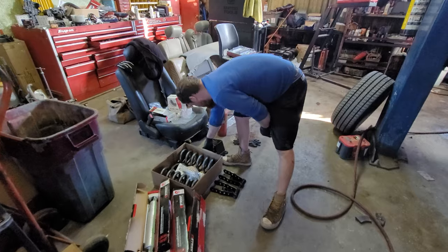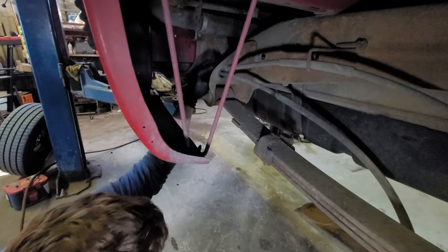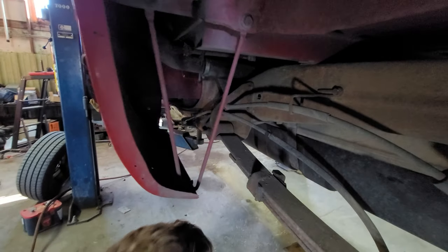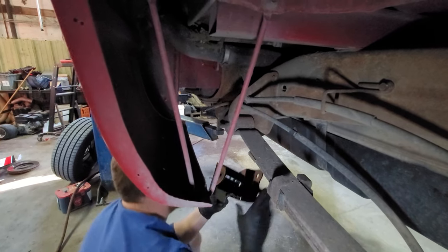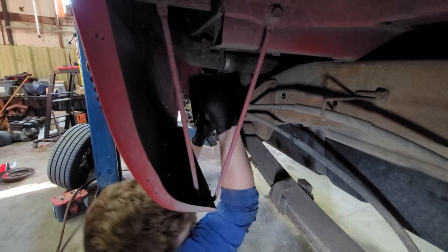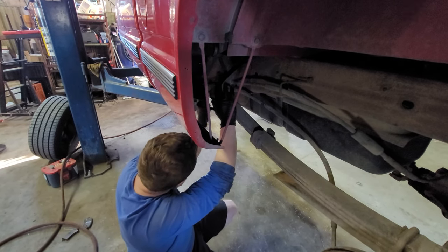But look at this big difference. The problem that I was talking about is right here. These cables go through that. The last one I did, they bolted to it. So we have to unhook the cable potentially, or I'm going to have to cut that and slide these out. If you look, this will come up in here like this and sit like that. So you move your leaf spring up here, but it still maintains on top of the rear axle. It's not a flip kit, but that will drop it substantially.